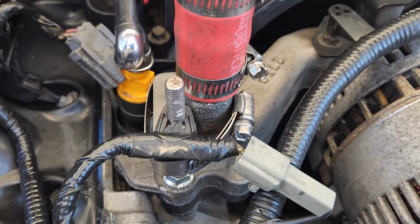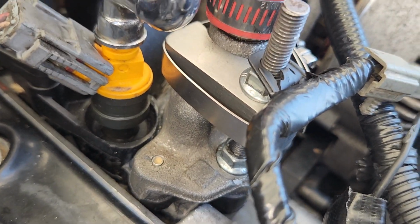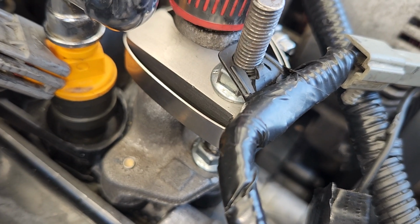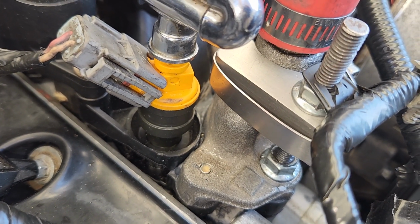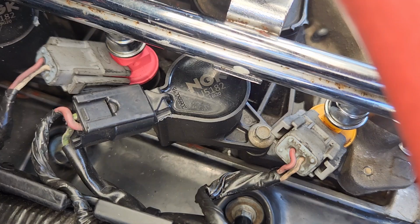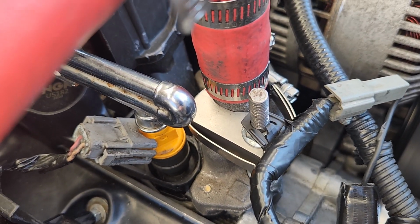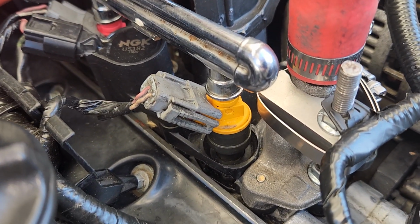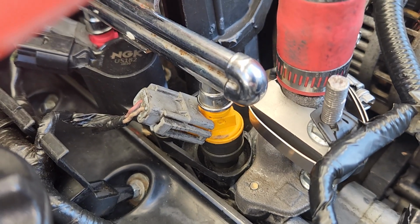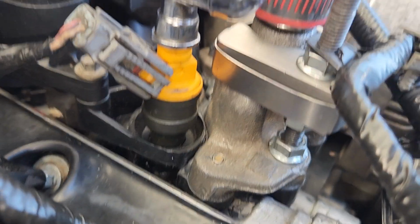We got the 3/4 inch coming up off of the intake manifold. And then you see there is my stainless steel adapter to press down on the other side of the crossover tube, because Ford screwed up. They put a bolt there and a bolt back here, you see it just below the fuel injector. So you've got about a 5-inch gap where there's no bolt, and so it tends to leak on the inside between the first cylinder intake and the crossover tube, and that stainless steel bar presses down and keeps the pressure on there.